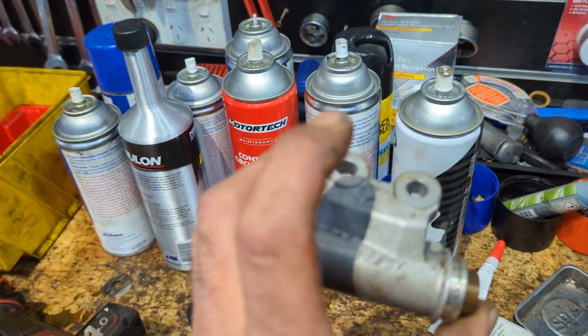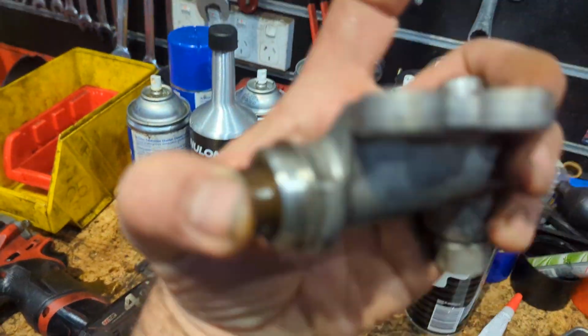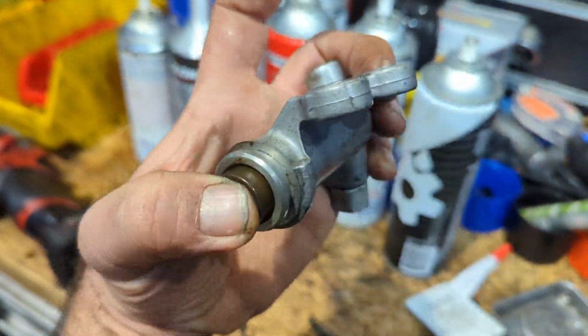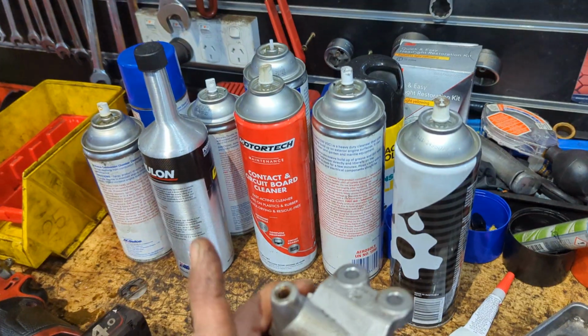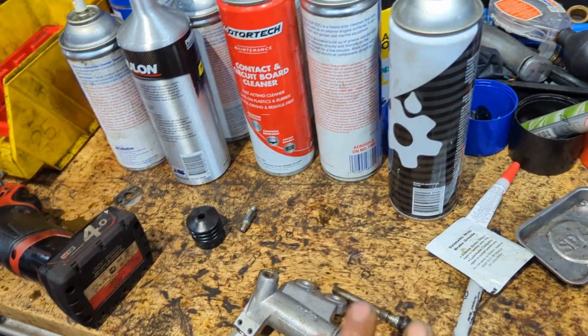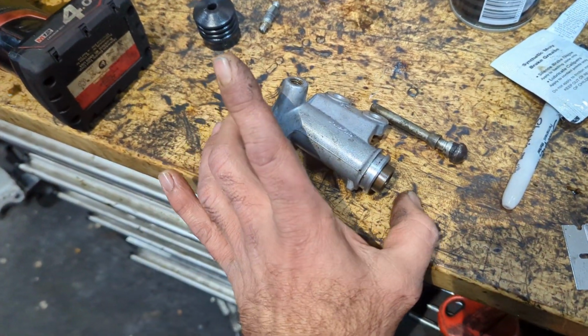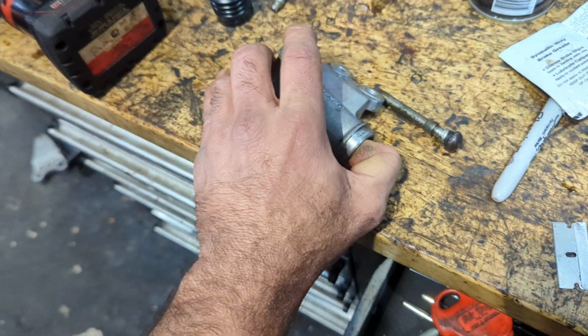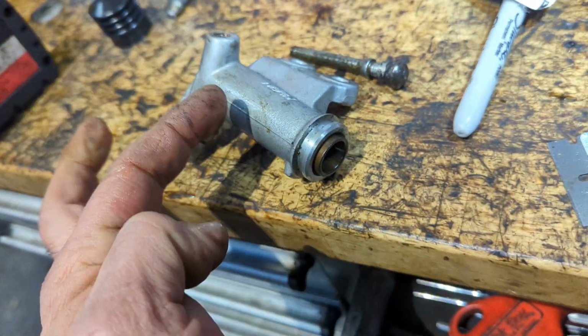Now, take the 2 bolts out, rotate the cylinder around like this. It's now going to be on the pipe. Honda have designed it to do so. It's designed to turn. Now, operate the push rod with 1 finger. It is much easier without the push rod in, but don't do it without the push rod in. Operate it, release. And you'll see how slowly it recuperates back.